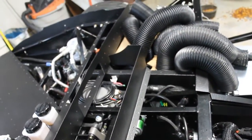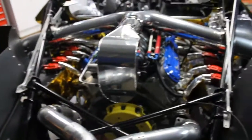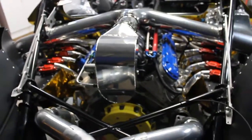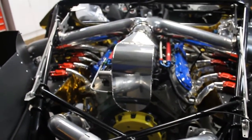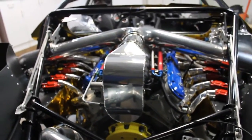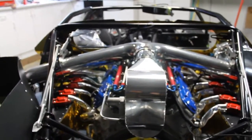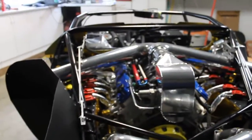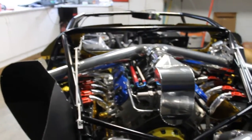That cardboard mockup will help me come up with a different plan. As far as the motor goes, I've been researching it — turns out you cannot get the lifters out without taking the head off. So I've got some decisions to make: if I'm going through the extremes of pulling the head off, should I replace all the lifters? Should I go ahead and just upgrade to performance heads and cam and just get it done right now?